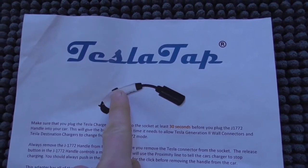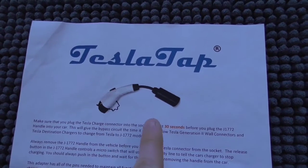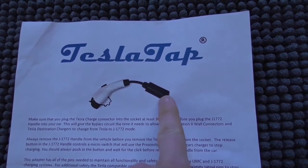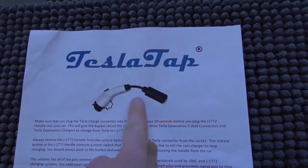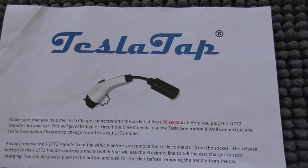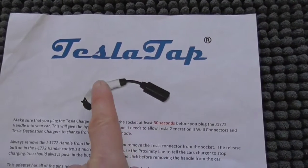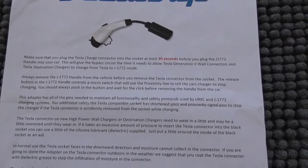When it comes to releasing, you have to push this button first and wait until you hear a clicking sound — probably two or three seconds. That clicking sound means the Tesla cord is unlocking from the adapter. Then you can pull this out of your car and release the adapter from the cord. You have to do it in that sequence; if you don't, you'll have issues because once it locks, nothing will separate it except pushing the button first.